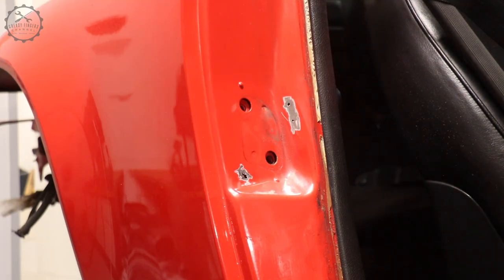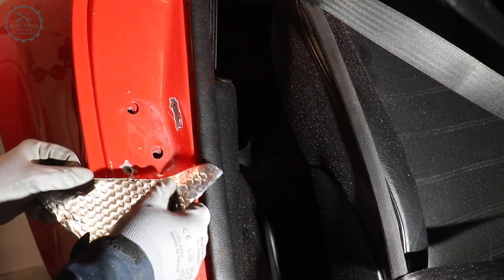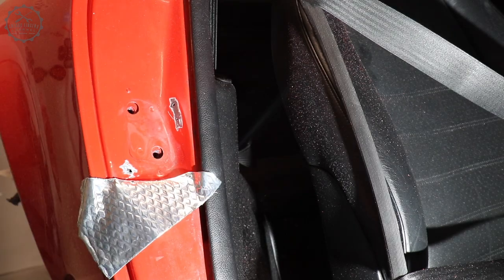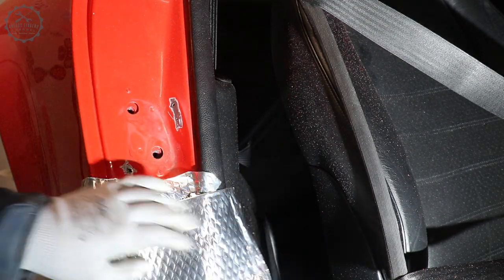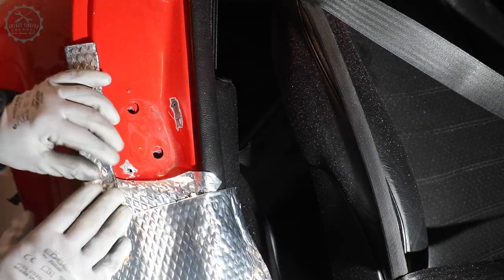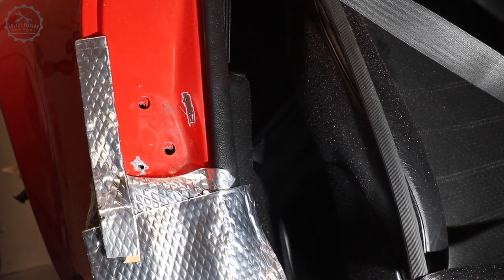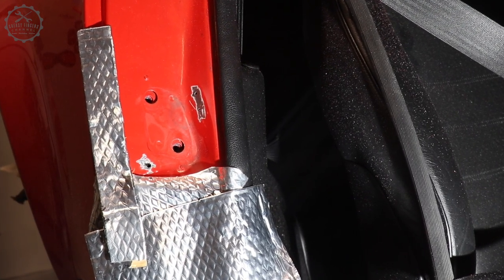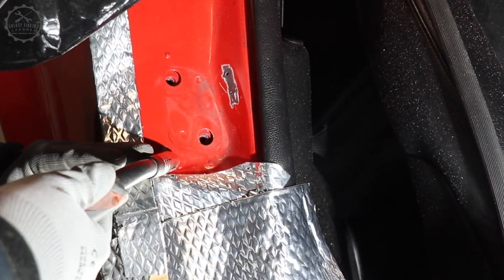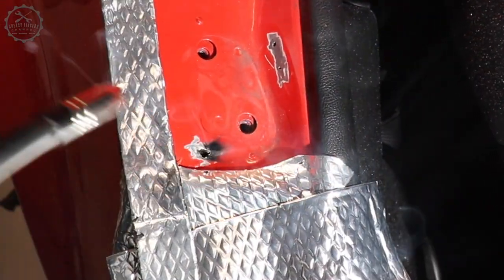I thought about welding in some self-made repair panels, but I first wanted to give it a try to simply weld the holes up. It's of course hopeless to think that pointing the gun into the hole will just fill it up and all will be fine. One needs to identify the places where the material is firm enough to take a welding spot at all and build up some thickness there. The idea is to basically create a torus around the hole before it can be closed. Let's listen to the sound of welding.